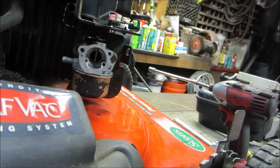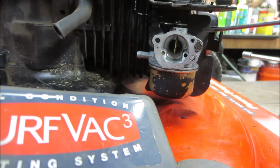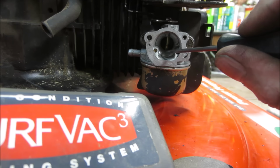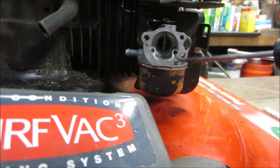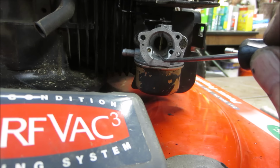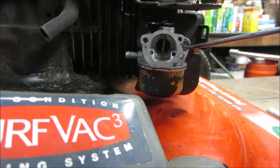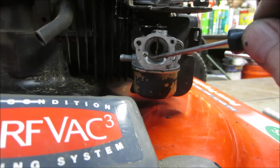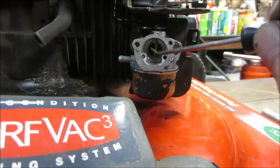So you push the button and you give a quick shot of air into the carburetor, and the float bowl gets a little bit of positive pressure, and then it'll push fuel right up the main jet hole, because essentially air gets pushed down inside there and that's under a vacuum. And you give it a primer, it gives it a couple of dribbles of fuel into the carb as it goes to start. Now the bowl's vented anyway. I do believe that is going to be the vent right there, that one. So you push the bulb in, the air can't escape fast enough out of there, so you're able to push enough of a charge, dumps the fuel in, a little bit of air kind of squirts through there. But the bulb needs to be able to breathe and vent also, so I think normally it just kind of draws through that little hole right there. I believe that is how it works, not positive of that, but I'm pretty sure that's the situation on that.